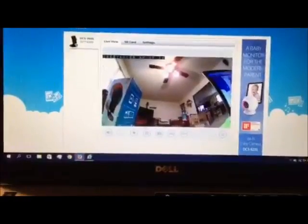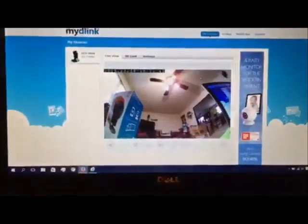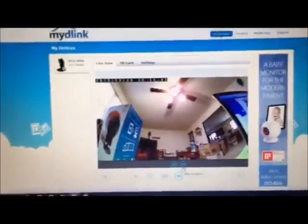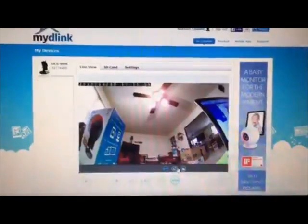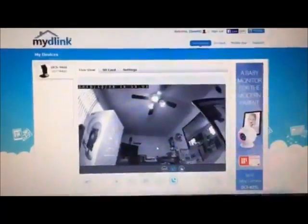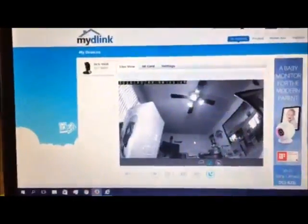The zoom does not work — I think that's how I locked it up earlier. You can take a snapshot and choose a default location to save it. You can change from 480p to HD. There's also auto day/night mode. I'll turn on night view — it starts viewing in night mode and turns on the infrared LEDs, which have about a 15 to 16 foot range.